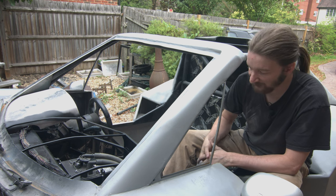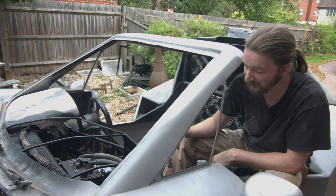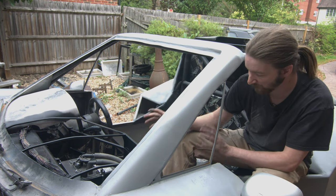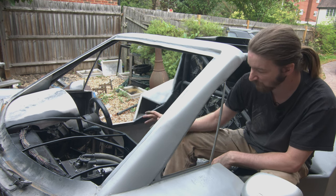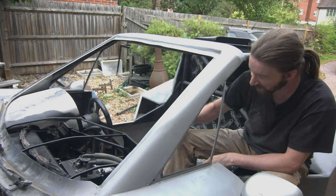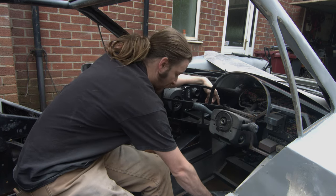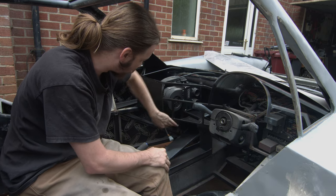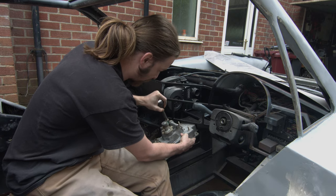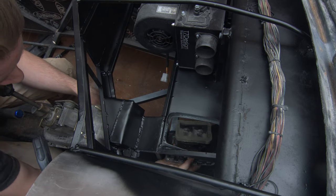While Aide's been working on the grill, I've had a crack at our one job per episode on the dashboard. We're determined not to let it languish. I've been welding up more of the structure underneath, making sure it's fully coupled into the body everywhere it needs to be — which means finally it's ready to paint. We've got a nice layer of black paint over it, so now if we had the foam we could skin it and it'd be pretty much good to go. I've radiused under all these sections, added quarter pipe pieces all the way across, boxed in around the front of the gear shifter so that now fits, and cut a big hole in the front plate for our low-mount air vent.